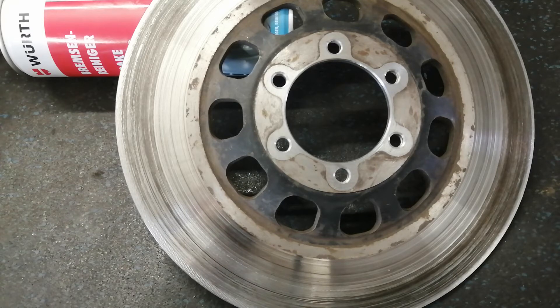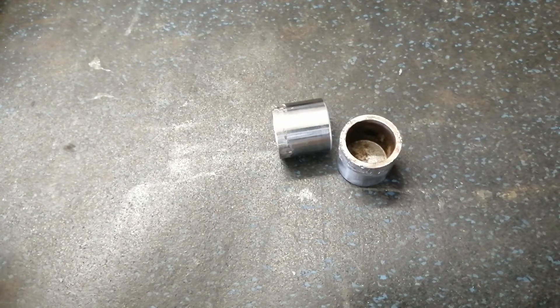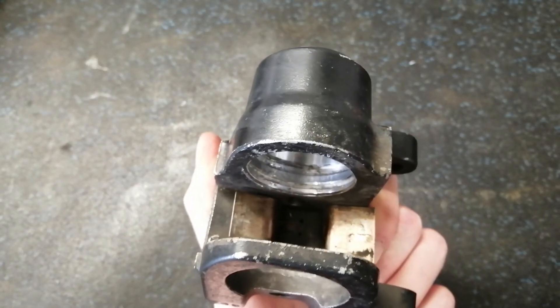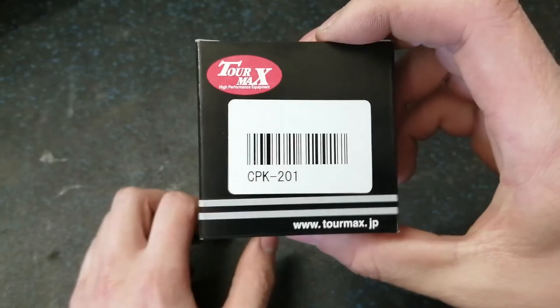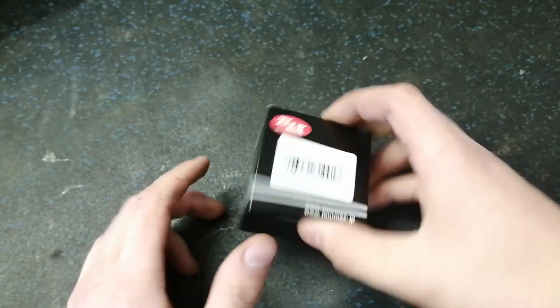Let's continue on with the brake calipers. These are the old brake pistons and they were stuck — both of them — and ugly things happened with the vice grips, blow torches, and WD-40. They live right in here; you have two grooves in there where the seals go, so just get them as clean as you can. I got these TORMAX repair kits for anyone interested.